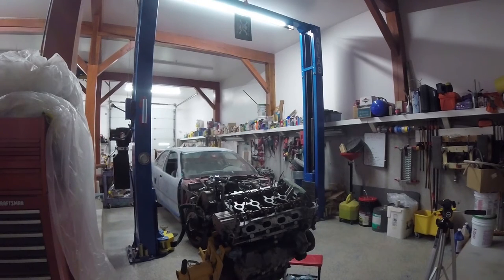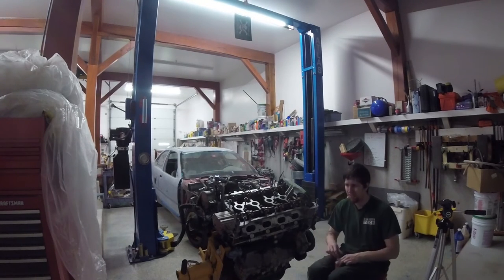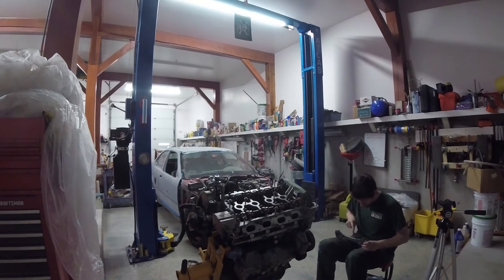That thing I was working on was the front motor mount sub-bracket. The motor mounts on this car — at least on the front — are a multi-piece assembly. The one on the transmission is a single-piece assembly, but on this one there's the engine hanger piece, the motor mount, and then the frame piece. You do have to take that whole bracket off to get the engine to drop down. You then need to over-lift the engine to put that bracket back on and then set it back down on the motor mount itself. Fairly easy if you've got the sub-frame off and can get a jack with a couple of 2x4s or a nice rubber pad on it.